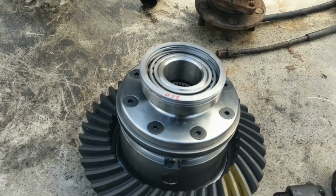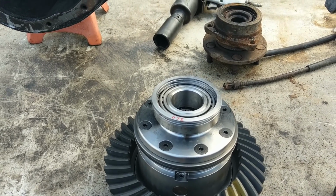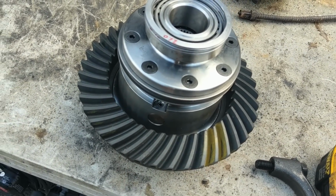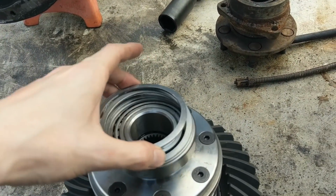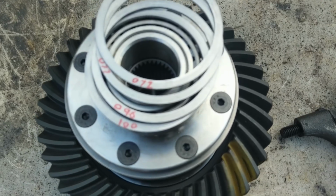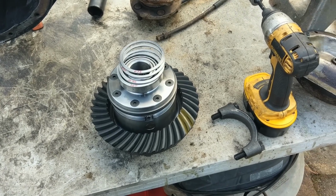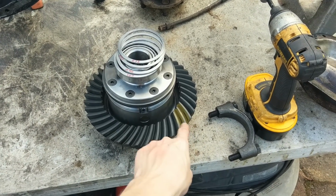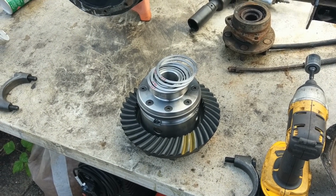He said he thought it was really weird that we couldn't fit both of those thick shims in that he gave us, the 174 and 178. I couldn't get anywhere close to that. This ox locker is for a JK Dana 44. He's thinking it might be thicker, and goofy him never measured to find out. So I gave him the measurement that I could fit in there, and then he cut out some more specific spacers for me. So we have 200s and 275s to try. Now we should be able to slide it in and center it, and go back to the original start point of 25 thou on the pinion depth and see what kind of pattern we get. Because he wasn't happy with how sharp it was, and I thought that was a little weird too. So I don't know, it's custom.